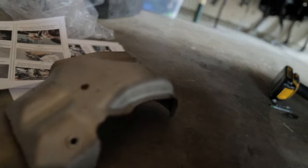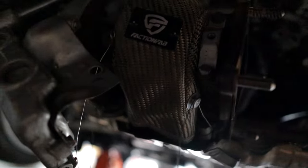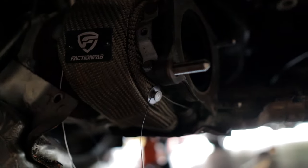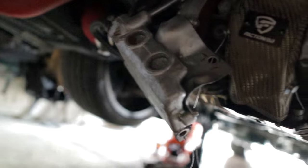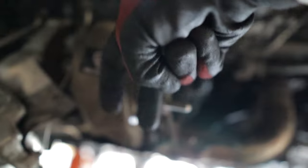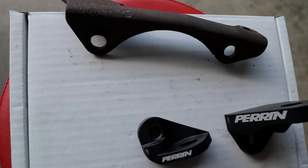What's unfortunate about this kit is that I do have to put the heat shield back over it, which covers it up — and I'm kind of sad about that because look how pretty this thing is. A couple tips: I removed the heat shield to give more room, and I dropped the header pretty far off the studs to give more room in the back to move around and get the wires out from the other side to tighten it down.